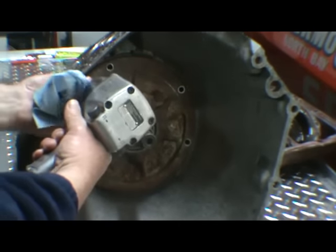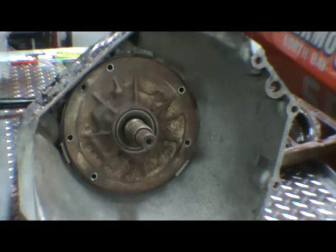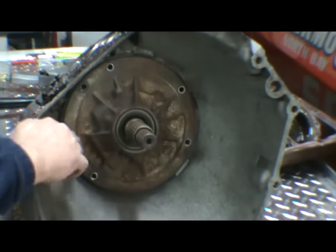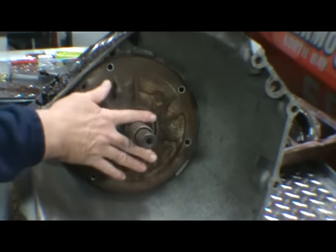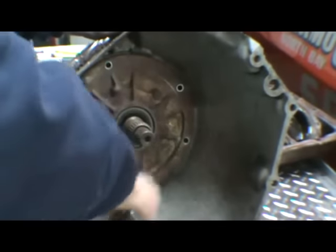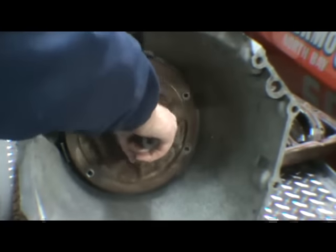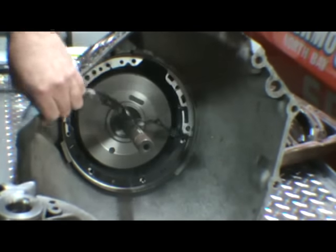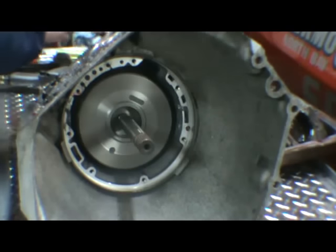Okay, so this pump has six bolt holes. I've taken the other five already out. That's the last one holding the pump into the case. Now there are two threaded holes, one here and one here, for a slide hammer type puller. There's also pullers you can clamp on here, which push on the input shaft, which pull the pump out. I usually find that they haven't been in there for a long time. Just a rubber mallet will usually loosen them enough to get them out. Pump gasket, case gasket. We'll take the pump apart at a later date. We'll go through it.